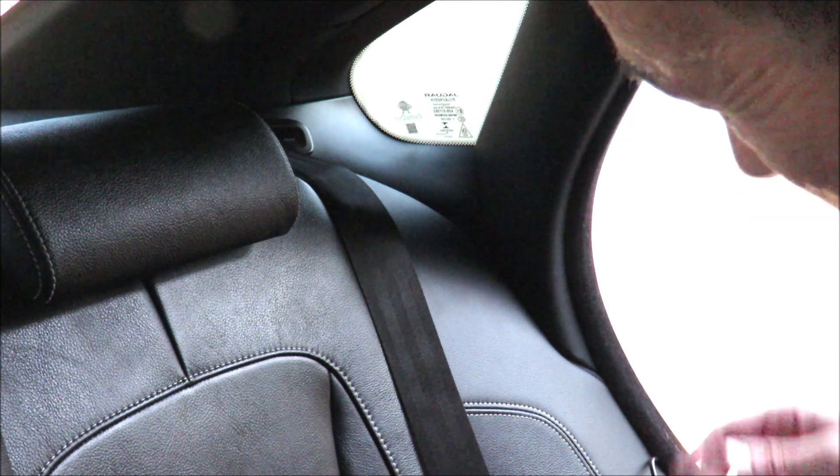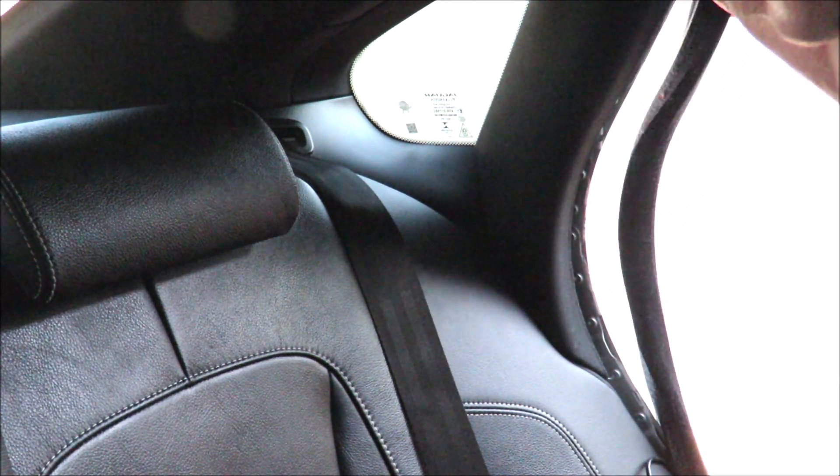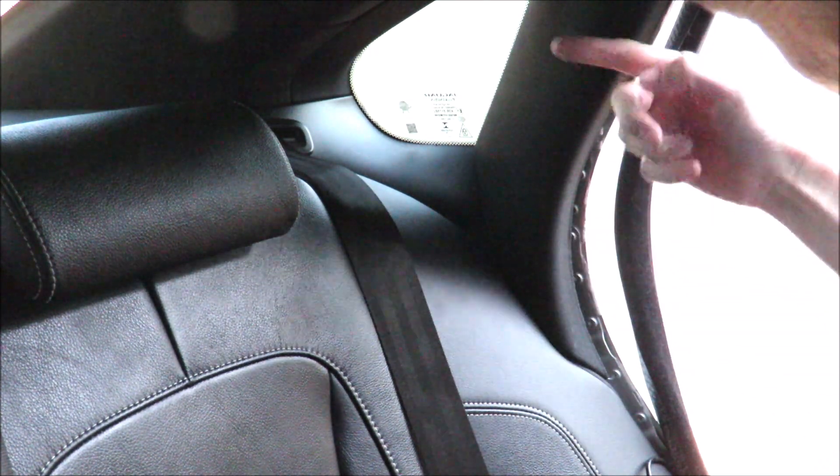It's kind of difficult to see because it's still a bit dark in the car. I'm going to pull this rubber away from the side — just pull it away — and then you can actually unclip this part here. There where it says airbag, you need to remove this airbag sign with the trim tool — that's the easiest way to get it off. Then, like I did before, you need to use a screwdriver and get it into the clip, then release the clip inside. So I've unclipped the clip in here, and as you can see this piece is already coming away. I just need to unclip that piece over there — there's a clip over there and a clip down there. I've put everything back together.